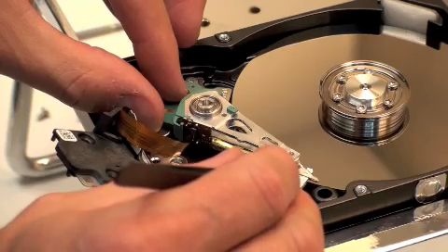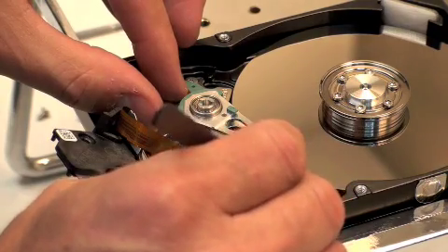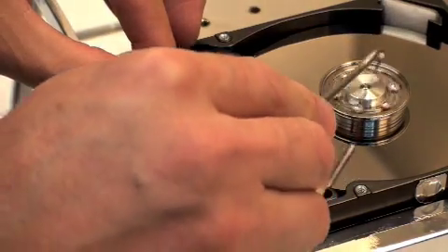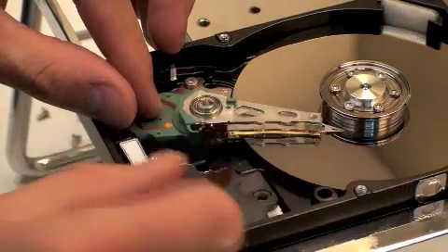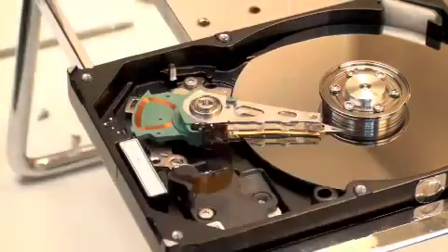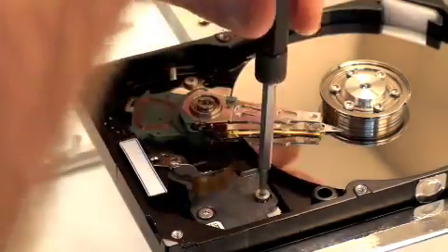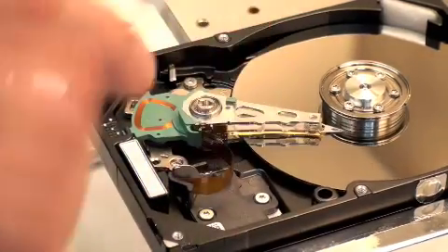You're basically holding that in the back and pushing it up there and then you will remove that piece of foil as carefully as possible. And then turn the platters so that the platters are not having any kind of problems with the head sticking to them and pulling the heads off. And you put them in the park position and then you reassemble your drive. This is the basics of how you can do a head replacement much easier than some of the other methods that are out there. I've seen a couple of other people post other videos and they've given me credit for some different methods, and I appreciate it. This might help them out with some newer methods that might solve some of their current problems with trying to cut straws and trying to cut other pieces of plastic to fit in between.